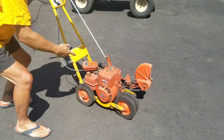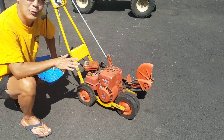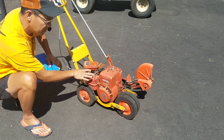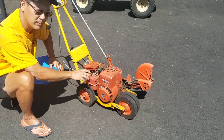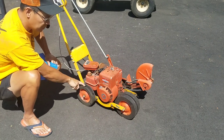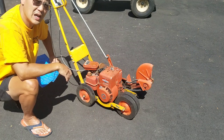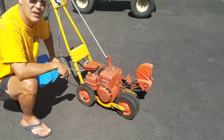Also, as you know, I got this McLean edger from my friend Larry over in Hauppauge. He didn't want it. I didn't really want it because it has this old Briggs setup, where it's the ball bearing type recoil starter, and it probably has a points magneto, which I don't like to deal with. Also, this Pulsajet type diaphragm carburetor setup. I've worked on a bunch of these, usually for vac chippers, chipper shredders, and old Little Wonder ground blowers. The linkages are a nightmare to work on. It also has a damaged wheel and it's missing a blade. So it would cost me more money to get this working than it would actually be worth. My friend Nick from Lindenhurst, 5-speed ash, told me this thing's worth like $250. I'm like, just like Scott Taylor told me those Snappers were worth $400.